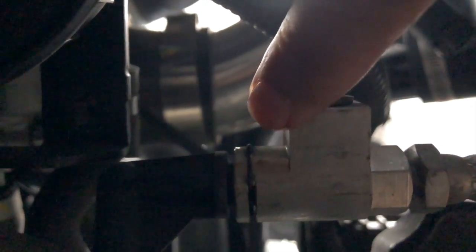What we're gonna do is get another bucket for my brake fluid. This is the bleeder valve. You can see it from on top, and I don't know if it's hard to see. Okay, right here there's a clip. To remove this from this piece, be very careful, this is plastic. When you guys start messing with this transmission, this is a good spot people try to grab onto. You will crack this, you need a new slave cylinder, and that really sucks because they're about $120.